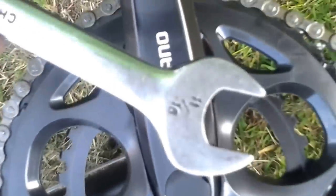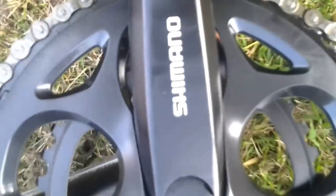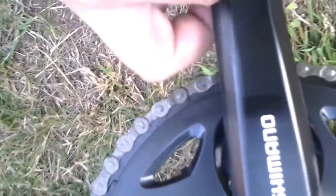So we're going to swap the pedals over. As you can see I've got the normal flat pedals for normal shoes. You just need a spanner — they're all the same size — and just undo it. Remember, with pedals one goes one way and one goes the other when you're undoing them: one's clockwise and one's anti-clockwise. Because when you pedal forward, if they were both the same thread direction, you'd actually be undoing one of them. They're designed so that pedalling works against loosening.